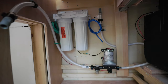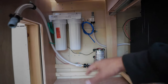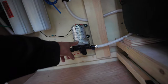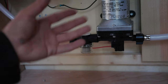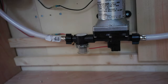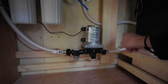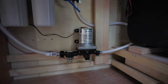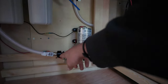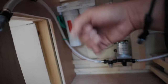I did the install on all of my water yesterday and I think it's correct, but we won't know for sure until we actually have some water and try this stuff out. This is my 12 volt water pump here by SureFlow. This little piece here is called a strainer — it will basically filter the water before it enters the pump so any debris in your tank isn't pulled into the pump and potentially damaging it. Hooked into the strainer and on the other end are these pump silencing hoses, also from SureFlow, which apparently keeps the pump a lot quieter. I ran it up here and used a hose clamp to hold it, and this will hook into my water tanks with a quick disconnect.